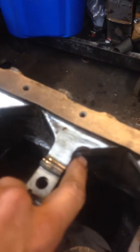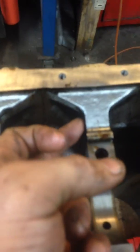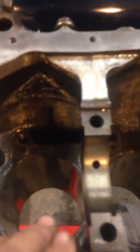The oil returns are right here — they're kind of machined, but they leave the casting rough there, so you've got to smooth that out. All the undersides have to be beveled and smoothed out for oil scavenging. The same thing goes on this side on number two — it's only half machined, so you have to sand it out and smooth it out. This is one of the main oil drains right here, and some people will feed their turbo oil return line into this side of the block. There's a ton of flash when you open this motor up, and you've got to remove all of that and smooth it out so the oil will flow fast.